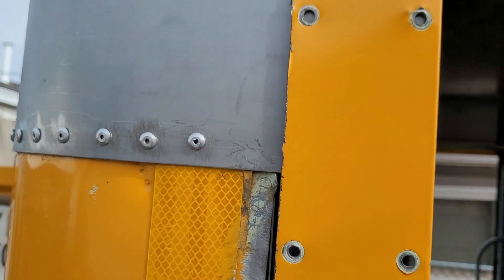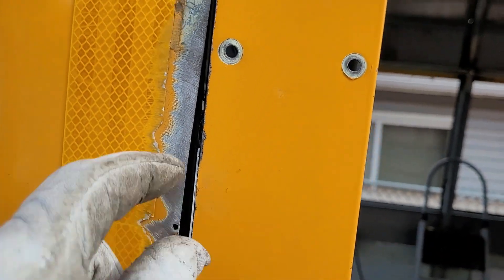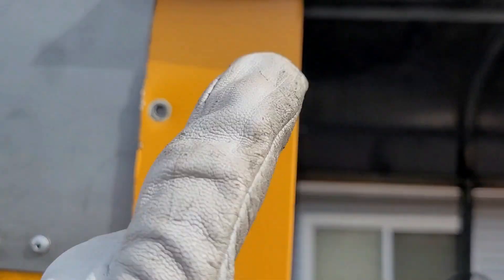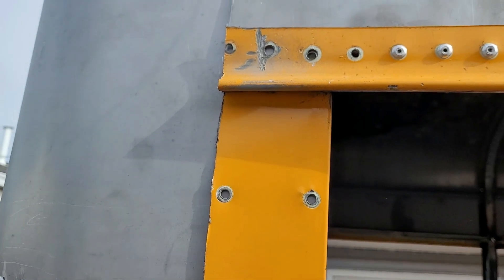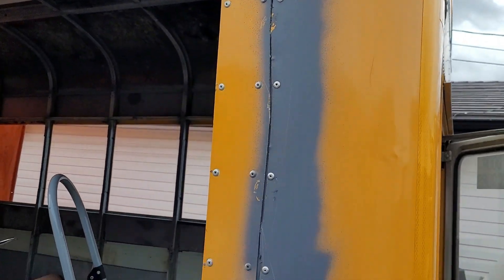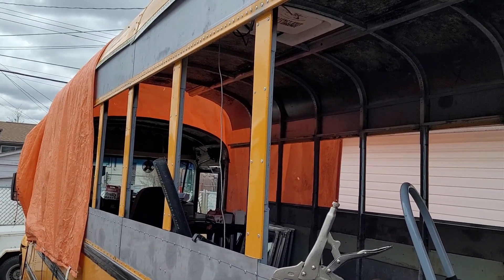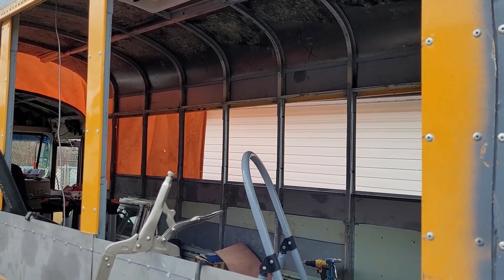Sorry about the wind, it's very windy out. I need to take this tin and trim it out so that this piece fits in here properly and I can line it up. I'm going to draw a line down here and across up here, then trim very gently with the grinder and not just blast through things. Both sides. A few hours later — the back panels are completely done. I've got lots of riveting to do but I'm a little sick of riveting, so I'm going to pull out the saw and start making some keepers for the pieces of tin and little blocks.